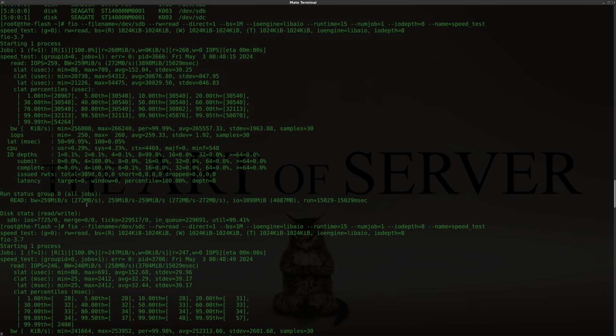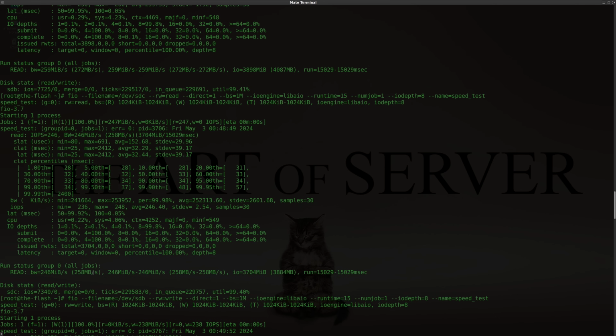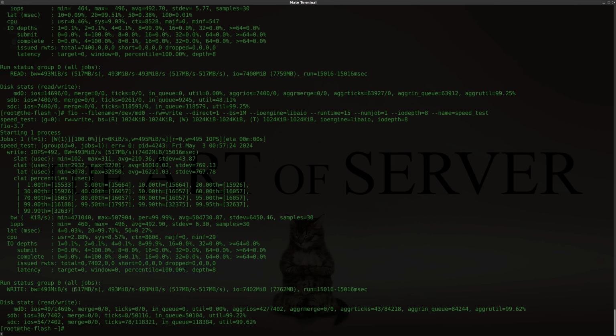Okay, so we're looking at 272 plus 258. If you were to add that up, that would be 530. So this is 517, so we're not exactly achieving double the speed, but still not bad, right? Okay, so let's do the write test. All right, in this case, we are getting, actually this is interesting, identical to their sequential read numbers. We are getting 517 megabytes per second.